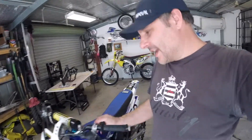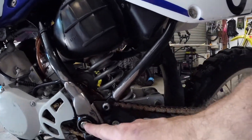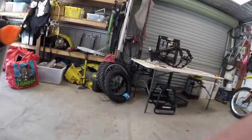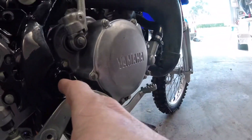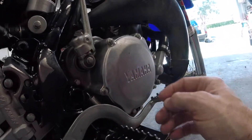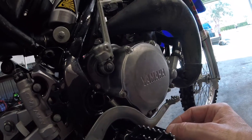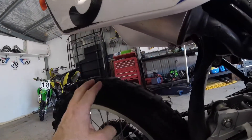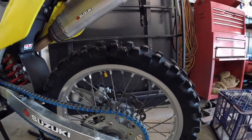The main problems are with Zach's bike. The swingarm bolt has actually snapped on the other side. His chain guide needs replacing — it's down to that steel bolt now. The biggest problem is the bolt has snapped on the inside and it's completely gone, so it's going to be a really hard job to get that off. We'll also change the rear tyre on his bike because it's buggered. And my RMZ250 came up with a flat tyre, so we need to deal with that as well. Let's get started.